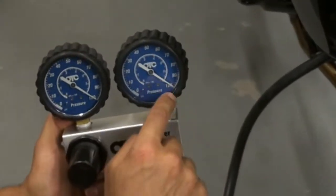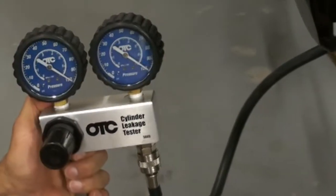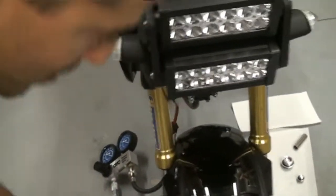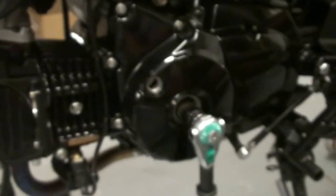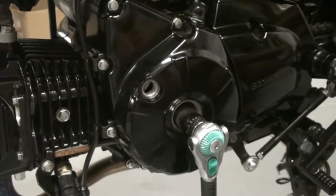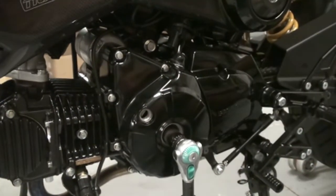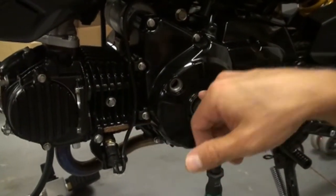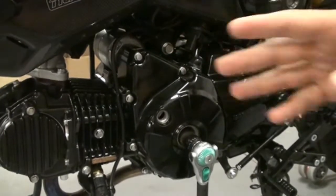The only place you should be hearing air coming out is through your crankcase. Basically, if you pulled your oil plug out - or in this case through the inspection covers we have out - you can hear the air getting by the piston rings, which is normal because piston rings have gaps on them, otherwise they would explode inside your cylinder. That's the only place you should hear air, and it should be just a little, little bit. Now, if we had 15 or 20% leak down and it was all rushing out of there, then you know your rings are gone - they're shot, or you've got damage to your cylinder. Either way, it's time to pull the motor apart.